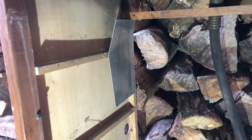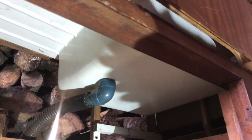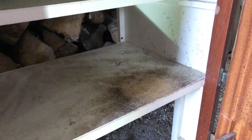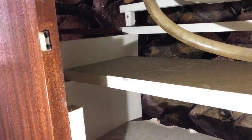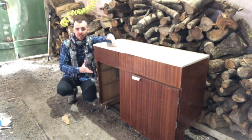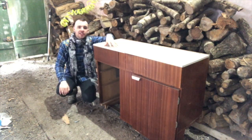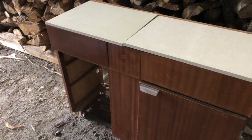If we take a closer look behind the scenes of the kitchen, you'll notice it's very, very thin — very small strips of wood. It appears like substantial furniture, but it's actually oak-faced entirely, and even the cupboard doors are hollow just to keep the weight down. This whole unit, minus any appliances, probably weighs no more than about 15 kilograms. That is what you need to aim for if you are replacing the kitchen in your caravan. My advice is: if you're planning a new kitchen, start with an old one and change and modify it. Sprite made it very simple to fit the fridge — you just remove a door on one side and the fridge simply slides in. So start with something that already exists, is a lightweight unit, and then change it to suit what you want.